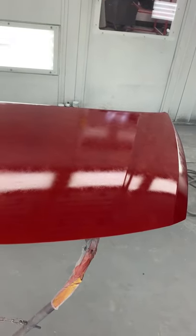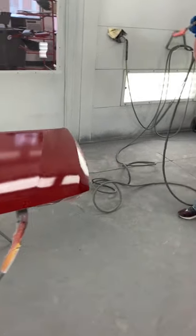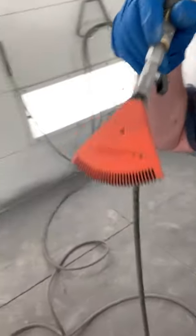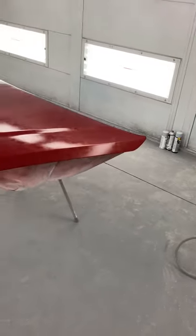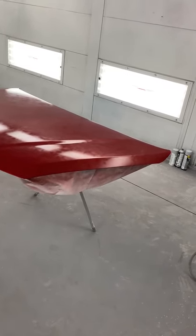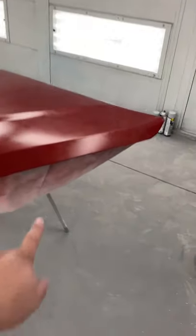You can see he got it wet enough to wet out but it's not glossy or glassy — nothing crazy. Now we're going to grab our air knife and blow off the panel. I want to blow up, not into it. These air amplifiers work really well, just not for students — if you get too close it will move paint. See how far Mike is standing back? That's probably about 20 psi, and we're really looking for where it flashes off.